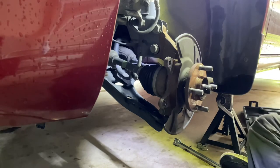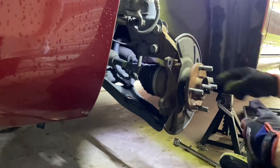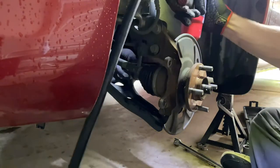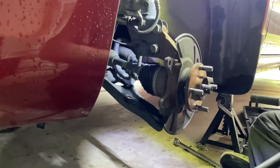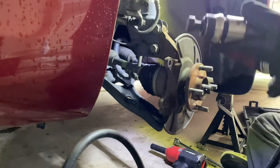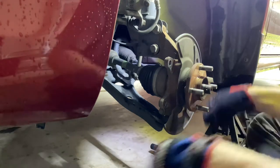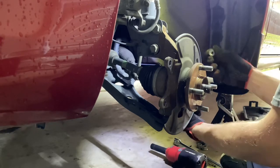All right, before we pull those out I'm going to get these other fasteners loose — looks like a 14. Bingo, so tie rod end is the 14 millimeter. Before we take that all the way off, instead of just beating on the knuckle with a hammer, I'm going to see if hitting on the top side of the nut with the air hammer is a quicker process. And what do you know, it's out — that was successful. Screw the nut off the rest of the way. Your tie rod end is loose.